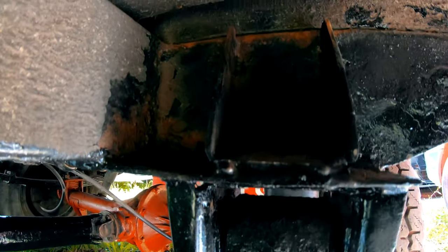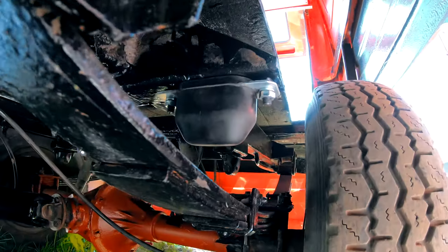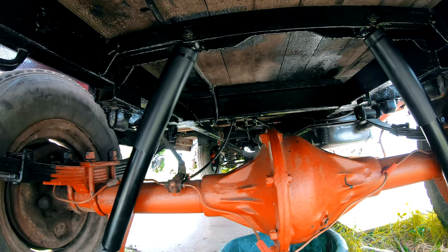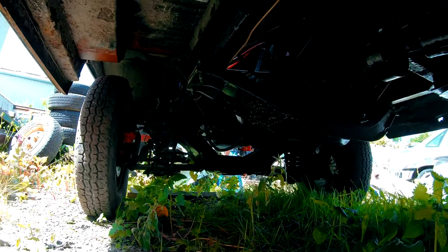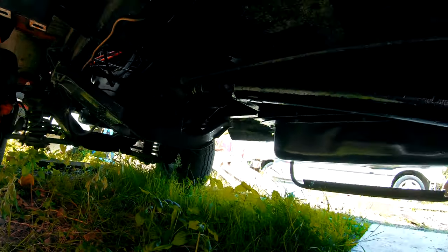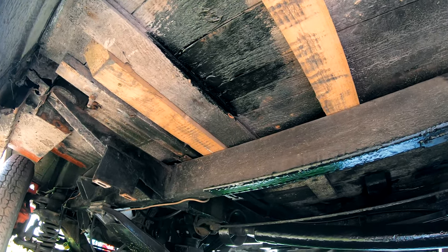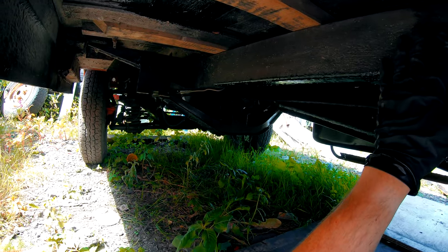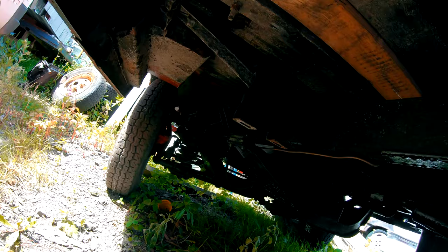Also, in my travels, I managed to find the first hole in the chassis itself — I'm not pleased about that. Hopefully a plate will sort that. I've also fitted new bump stops. Next up is some new shock absorbers, and then at some point — and I'm dreading this — all of the rubbers on the front suspension and new shock absorbers in the front as well. Right now I need to work out where the battery box is going to go and how it'll mount, but I think it'll go up here and I'll get this all painted up. With any luck I'll be able to get a battery out; if not, I'm going to make the whole box bolt on somehow.